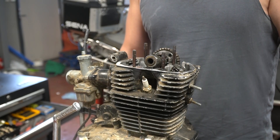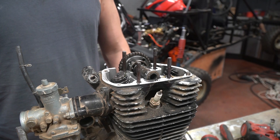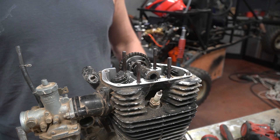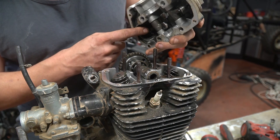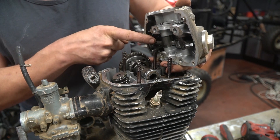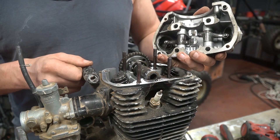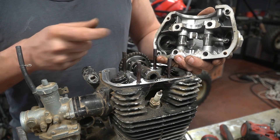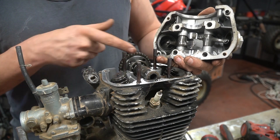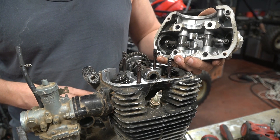Now it's time for a top tip you're not going to find anywhere else. The first thing to talk about is valve clearances and setting them. There are lots of different types of valves to be adjusted. In this case it's an overhead cam with rocker arms, and basically what you're doing is adjusting the distance between the cam and the rocker itself. This is done by adjusting the tappets here. There are loads of other types — shim over bucket, shim under bucket, tappets along with push rods — but essentially all you're doing is adjusting the gap between this and this, and that doesn't change between engines.